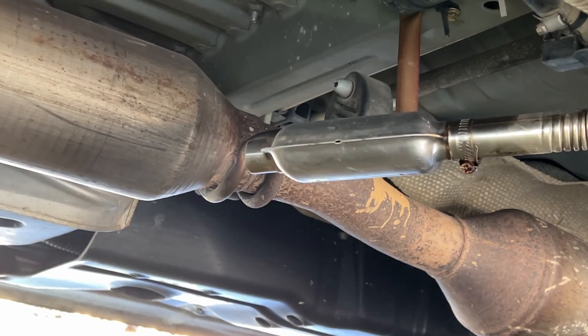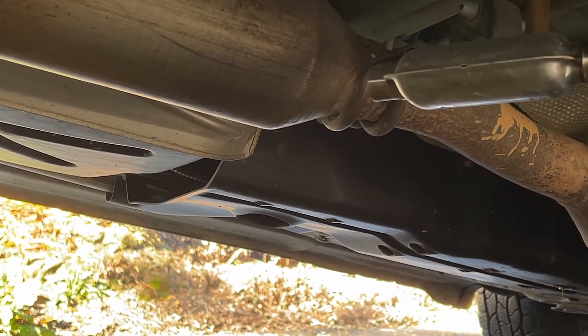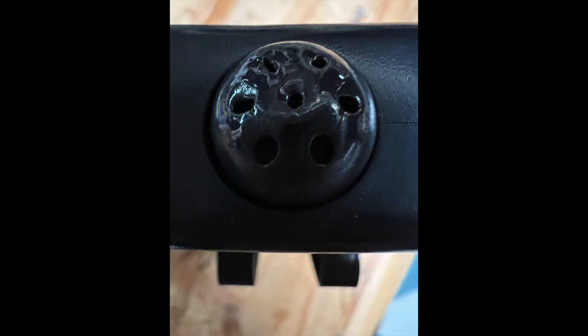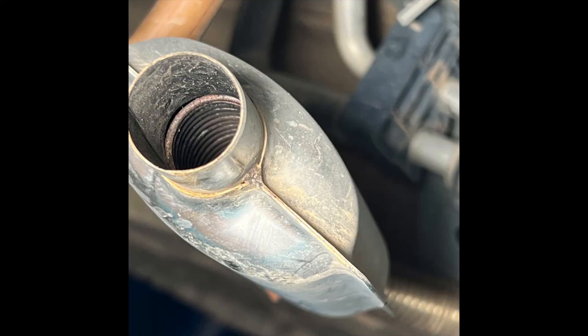The notorious pump ticking is now shortened up dramatically from startup. I bought a CO monitor to try to dial in the settings on my controller. As part of the testing I used a meat thermometer to check the temperature coming out of the heater, and the heat from the exhaust was actually too much for the CO monitor, so I had to drill that out again to make it work. For cold weather I've been putting in about 20% kerosene to the diesel, and it has clearly made the exhaust much cleaner.